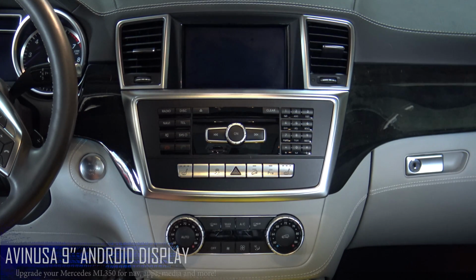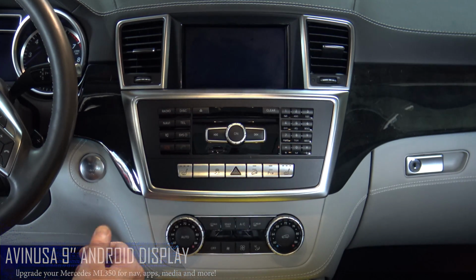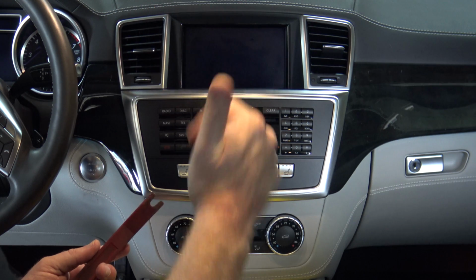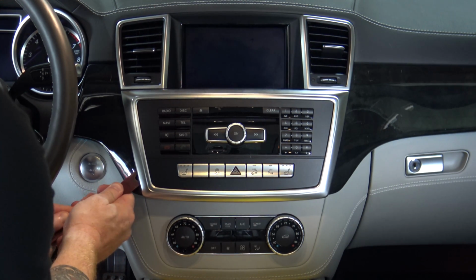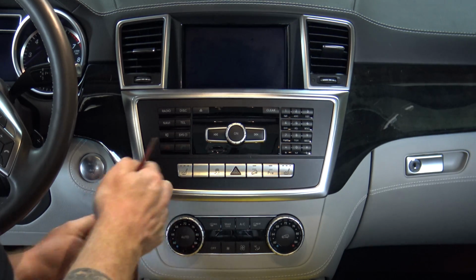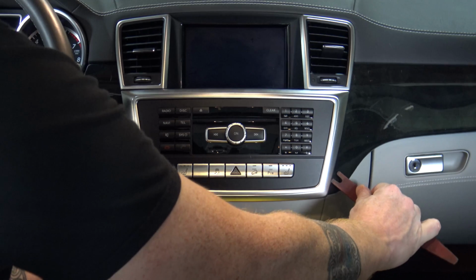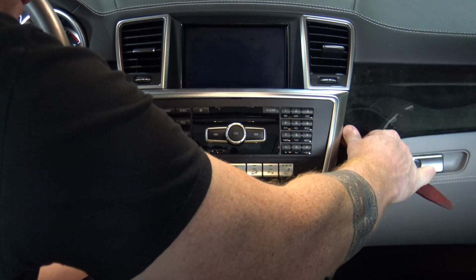All right, so the very first thing we want to do is remove this bezel around the outside of the command unit. So always use a plastic trim tool. The kit will be listed in the description of the video. Just work it in gently here in the plastic and gently work it up. There's 4 posts, 1, 2, 3, 4, that all hold this into place. So you don't want to pry on it too hard. You just want to slowly work it up and work this out.